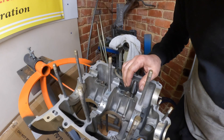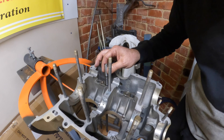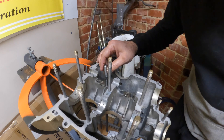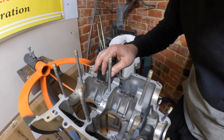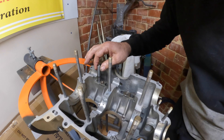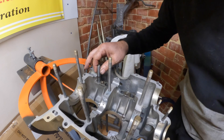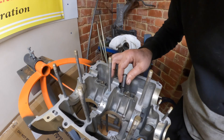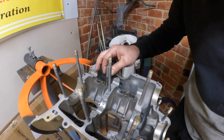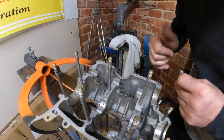What we're doing now is just testing these lifters to make sure they fall under their own weight with a little bit of assembly lube on them. You can see they're quite finicky to get them adjusted properly. They're not excessive - quite dry. They look square to the camshaft. All we've got to do now is tighten them and then bend our little tab over to stop them coming loose and we're all good.